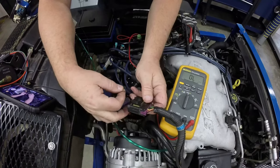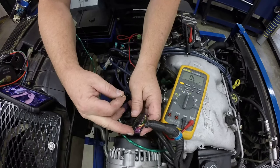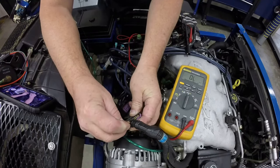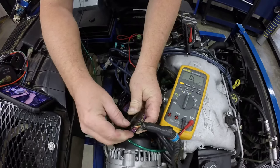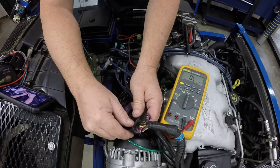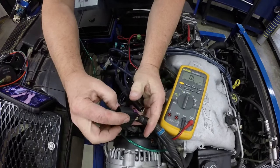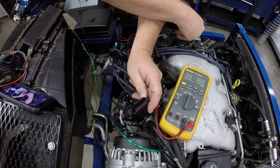I'm going to disconnect that and then go to the injector side of the harness. If you look back at the video I did on the injector waveform, I looked up the wiring diagrams for this particular vehicle and for each one of the injectors there's a pink wire going to it. So what I did is I'm back-probing one pink wire which is common to all of the injectors, and once I back-probe that I can clip my meter onto it. Now I've got a good ground for my meter and I can go through and test the rest of the injectors.